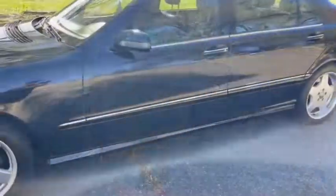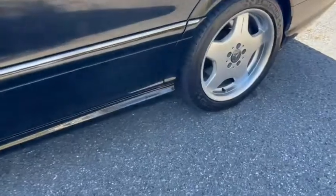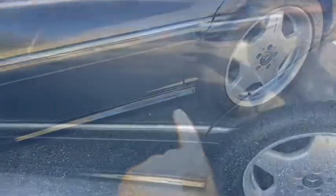I just quickly wanted to show you guys how I usually jack up the car and make it feel a little bit safe. You have to do what you have to do because the car weighs — if you look on the driver's side on the door sill — you'll see that the car weighs almost 6,000 pounds. You have a jacking point that's directly underneath here, and if you come to the back, you have a jacking point that's right underneath of this spot here.